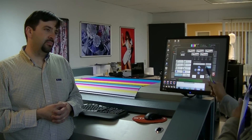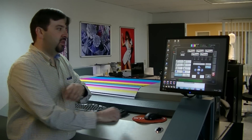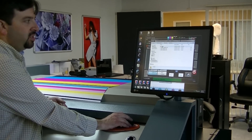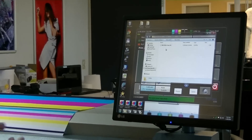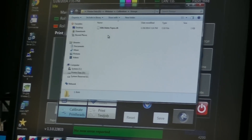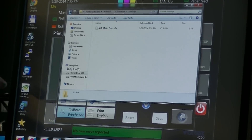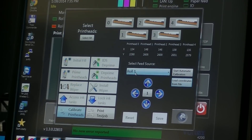It doesn't tell you the name of the currently loaded calibration, so if you loaded a file and then came back later you wouldn't know whether you loaded it or not. The system stores calibrations by feed position, not by media type. That's why when we copy the original calibration into storage, we save it and rename it something meaningful — not 'roll one' but '60-pound matte' — so that from the list of stored calibrations when we go to load, we can see which one we want to pick. Whatever source position is selected when we hit the load button is where that profile gets loaded into.